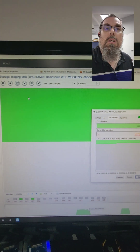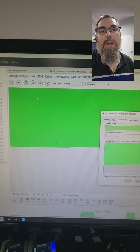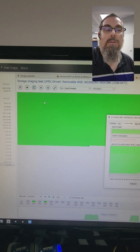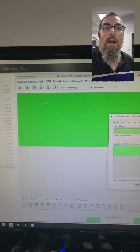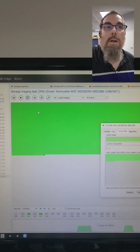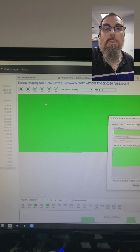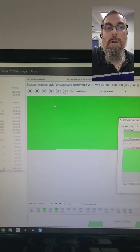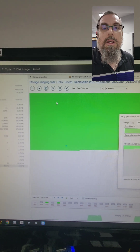Just on a side note, what's actually happening in the background is the clone drive is still getting encrypted data to it — it's still copying encrypted sectors to that drive. So if we were to try to access it directly, bypassing UFS and the encryption routine, we'd still be looking at gibberish and we'd have to use something to interpret it, whether we connect it back to the Western Digital USB bridge or what have you.